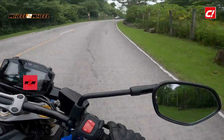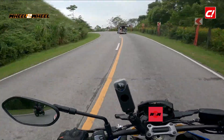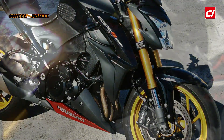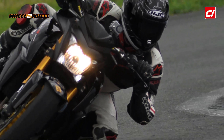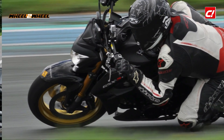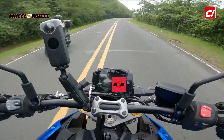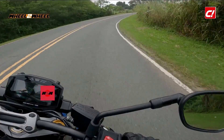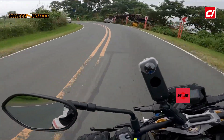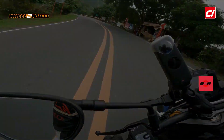It seems that Suzuki really listened to their customers, myself included. Most of the improvements done to this bike, I've done to my personal GSX-S, which I owned for 3 years — it was just because of the pandemic that I had to sell that bike, but I really loved it. The major problem with the snatchy throttle has been improved with the new ride-by-wire system. It's no longer snatchy, although I missed the direct feel of the cable throttle body actuation, but it's a lot easier to ride without having to spend for a reflash.